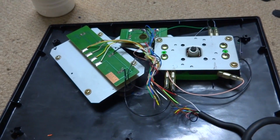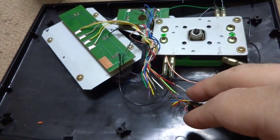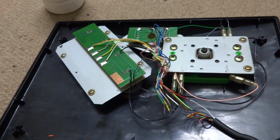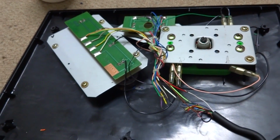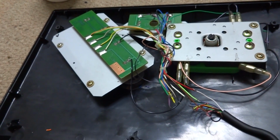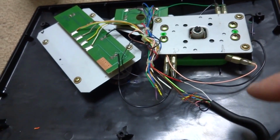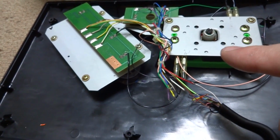Okay, so as you can see here, I'm about ready to start wiring stuff up. I wound up wiring one wire so far, and I thought that I could just go color by color and it would be easy, but after deciding to check it before I started wiring it, I found that the Neo Geo CD and the Neo Geo AES have different colors for the different pins. And the Neo Geo CD actually has 13 wires on it, and the Neo Geo AES controller has 12.